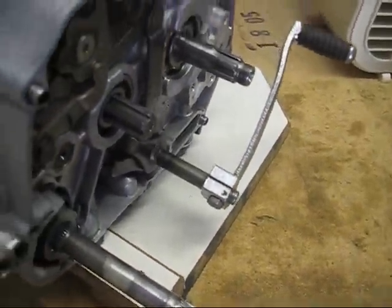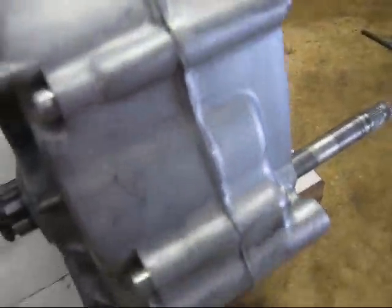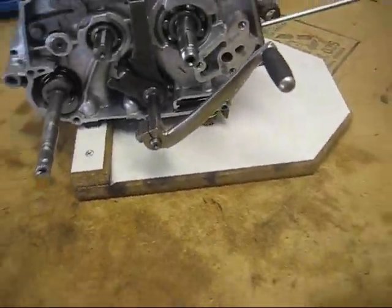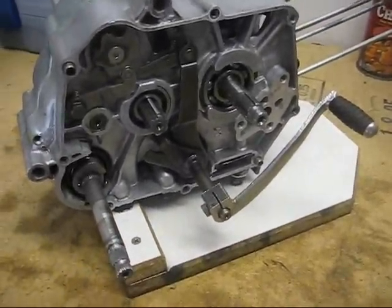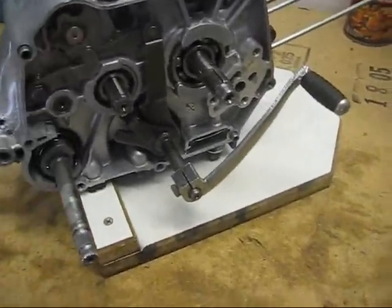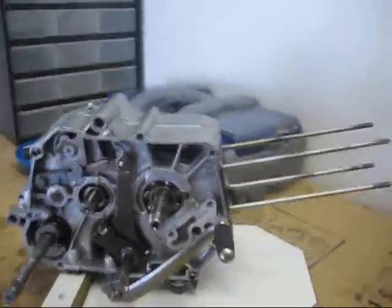1988 newer 50cc 3-speed motors, which includes the Z50R, XR50, and CR50, have 3 upshift patterns. Now there are also 4 down motors, 4 up motors, and 1 down 3 up motors. These are found on CT70H models, SL70s, XL70s, and ATC70s. Anyway,